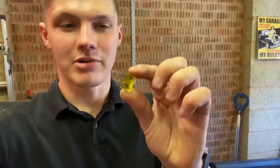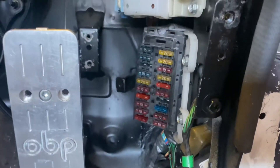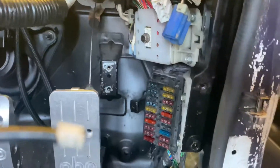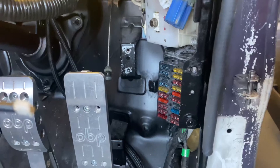It didn't start again that time. I must have a grounding problem because it keeps blowing a fuse — it's on the interior fuse box down by the kick panel. I tried a 15 and a 20 amp fuse but it keeps blowing, so I must have an earth problem somewhere. Turns out that fuse is for the air con, so technically we don't need it. I've looked around and all the earths seem good, so I'm just going to pull that fuse for now.